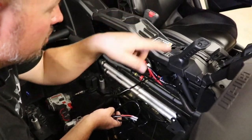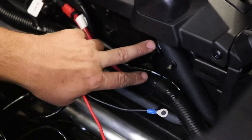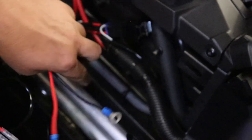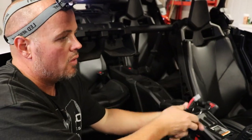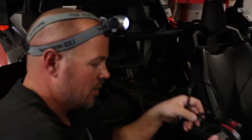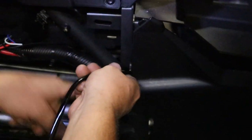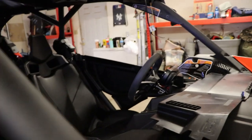The rocker switch was wired to the rocker switch wire that comes into this general harness area. We went ahead and put the relay on the little nut — just put it over a screw that had a little bit of extra thread left and put a nut on there to hold it in place. This is the final wire — the long one that's going to go all the way through the dash, up through the roll bar, and to the light bar itself. You're just going to run it through this little area, right under here and up through the back over your dash, and right up to the hole through the roll cage that'll lead up to the light bar.